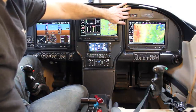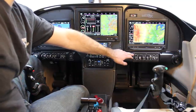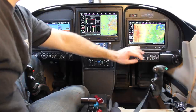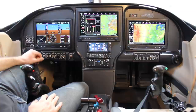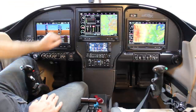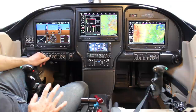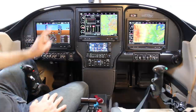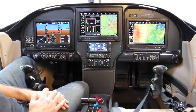I've got the ELT remote panel and a secondary switch panel that allows control of overhead air, heat, 12-volt power, and a USB power slot. Up above I have an AOA display — an angle of attack display mounted on the glare shield. And above all that, I've got my lighting switch panel.